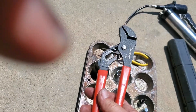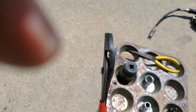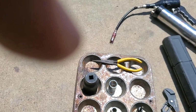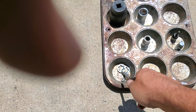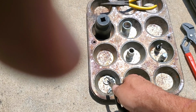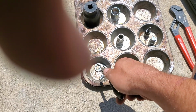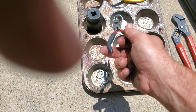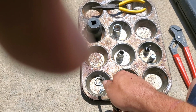You'll also need, just in case the slides want to move around, a thin wall adjustable wrench or adjustable pliers. You'll need a small pair of needle nose to get the retainers that hold your rotor in place. I saved on these. I did not put them back in the other side yet because I already knew that I was going to have to take it all back apart again, so I didn't put them back on, but I did manage to save them, and we'll reuse them, because really the only thing those are for is when they build the truck at the factory. That's how I know this front end has not come apart. When they put this together at the factory, they use those to hold the rotor in place until they put the rest of the braking system together.